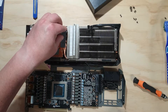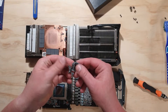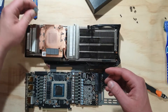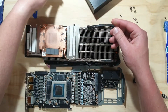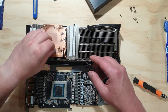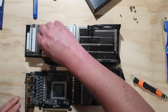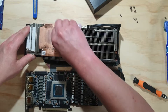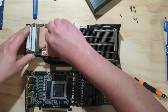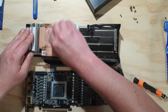As you can probably see, these pads are just ripping and leaving so much residue on this heatsink — just look at that, it's just crumbling. The heat pads get to this stage eventually, but I've only had this card for maybe a couple of months, so these are pretty bad quality. It really shouldn't be tearing at all — it should stay intact. But that's okay because we're changing them anyway. Now I have all this residue on here, and I have to get it all off first. You want to make sure you have a nice clear surface, because having that clean surface means when we put the new pads on, they'll have a good connection between the memory modules and the heatsink — that's our main goal, to drop those memory temperatures.